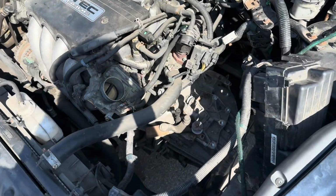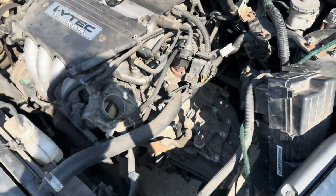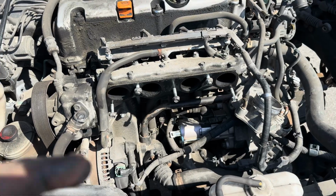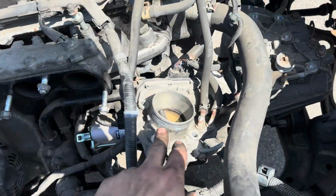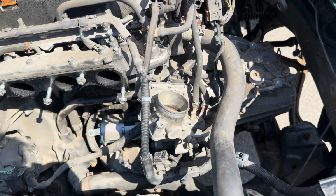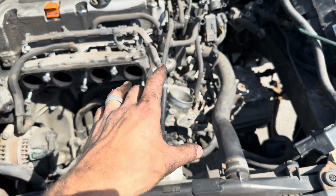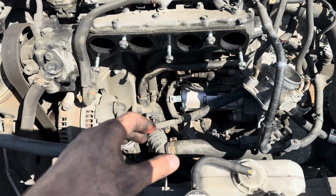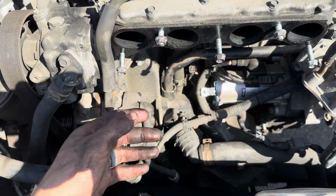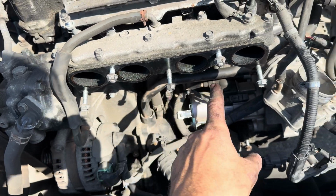And then basically the mounts, and we can get this transmission out of here. I just want to show you what I'm talking about. I did end up taking the whole intake out because there were only 4 extra bolts, the throttle body bolts, and then the throttle body separated from the intake. It was just too tight to separate it and just pull it aside. I couldn't get my tools in to get the starter. So here's all the bolts for the intake.